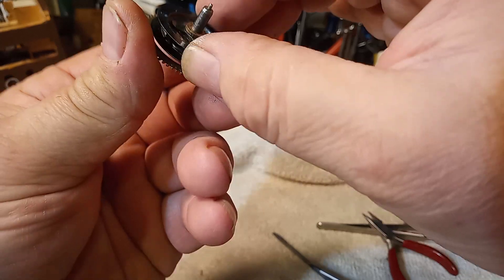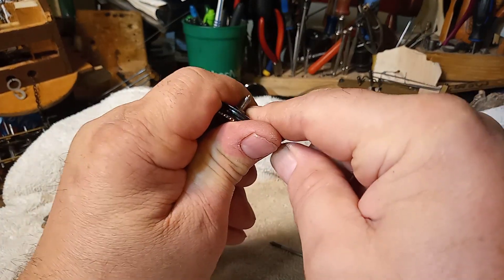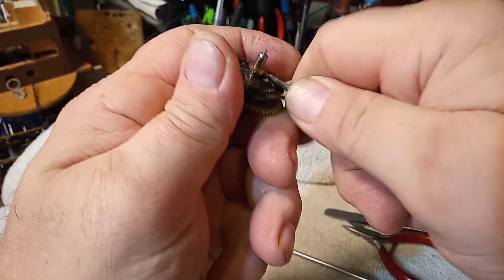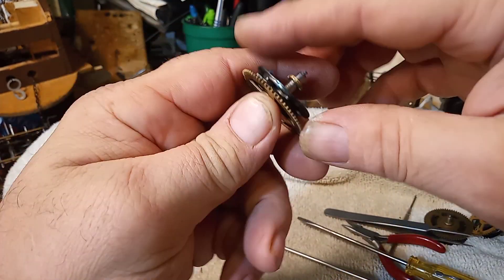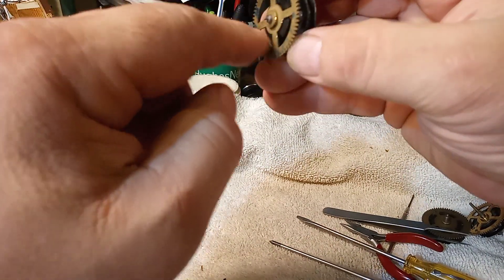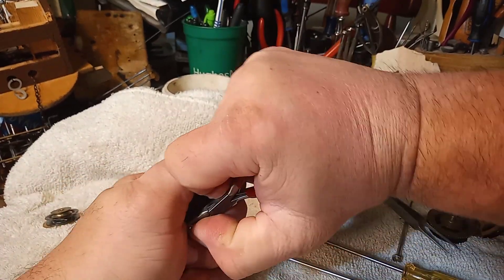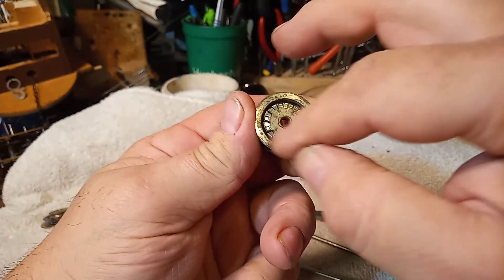This piece that the chain fits on is just one unit. Let me take it all the way apart so you can see what I'm talking about. Typically I would be using a pry bar to get this off so I don't bend it. But this is one unit — the part that the chain fits on — and then this part is what gives you the ratchet. The part that the chain fits on is what has the teeth in it that the click fits into.